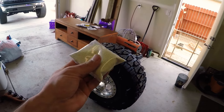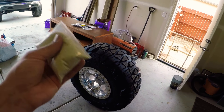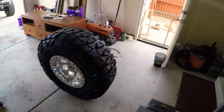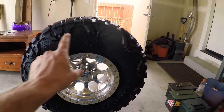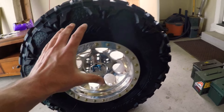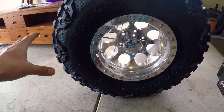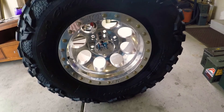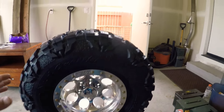If any of you have ever tried to balance even a 33 or 35-inch tire — these are 35s — it's darn near impossible or it takes a lot of weight. With the beads, they work perfectly every time. Every time you take off, the tire rebalances itself; the centrifugal force pulls the beads out to exactly where they need to be. Even if your tire is balanced and you get a clump of mud or some rocks, with normal weights it'll throw it off balance.